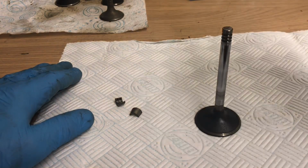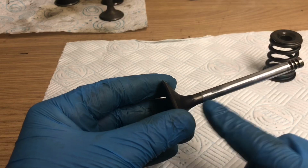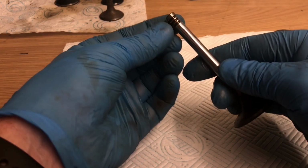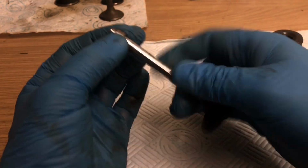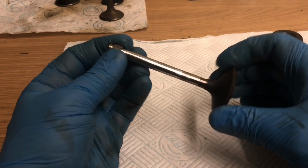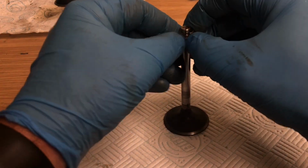And it's held in place by these fellas, the valve keepers, and these are ace. I've been doing a bit of research on valves and stuff. So these are a two-piece valve. You can actually see the two types of steel joined there. These differ from the one-piece valves, apparently, in some way. Anyway, the key thing about these valve keepers is, and they sit on there like this, that when they're pushed together, the valve can still spin. Can you see that? So it allows the valve during its actual life to rotate. There is a valve I've seen on here where you're required to file these keepers down, and what that does is that effectively stops the valve rotating, which is not a good thing, apparently. But there you go. So that's the amazing technology of what holds the valve in. It's just these two little things here.